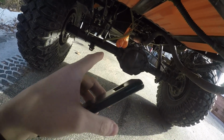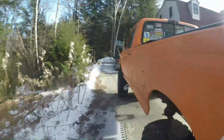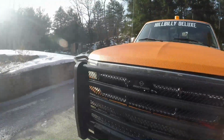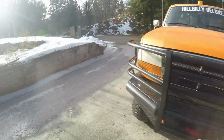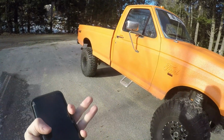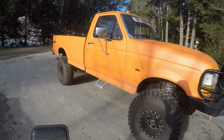So it's definitely going to be something that has to be figured out, because when I blew the fuse, if you guys remember when I was installing these lights up in my grill, I pretty much blew all the fuses trying to do it, and my transmission was shifting really hard because it messed with the speed sensor or something like that. So I know that if I don't hook that back up, not only is my odometer not going to work, my speedometer won't work, and my transmission is not going to shift right. So it's definitely something that needs to be addressed before this thing even leaves the driveway after that swap is done.